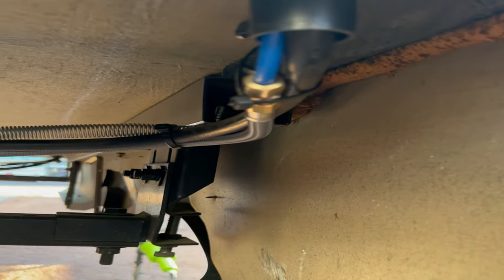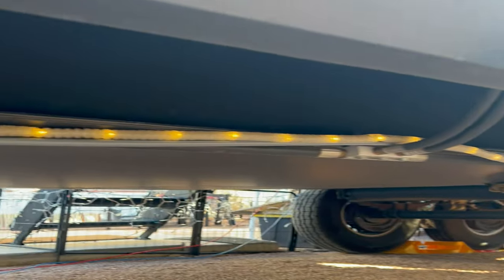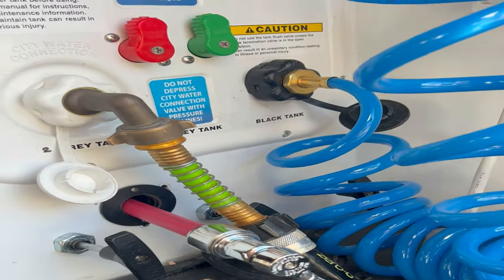Since this fridge came with an ice maker, what I did was follow the same route as the propane line, because the propane line's in the slide so I knew it wasn't going to get pinched. I got a braided water hose that runs outside, and we ran it all the way to the wet bay. Then I got a piece of PEX and tied into our existing water line that has constant water going to it, and I made a shutoff valve so I can shut the water off to the ice maker supply line if I need to.